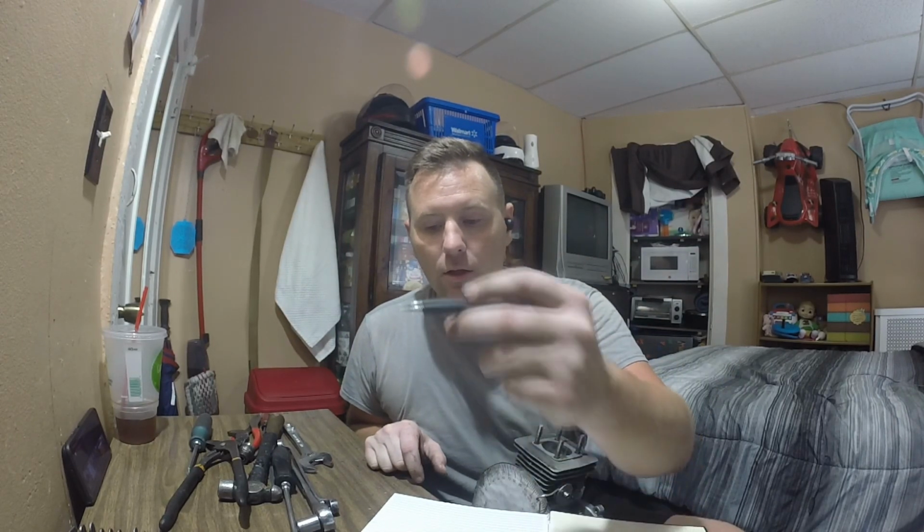What I have noticed, if you run your intake lower than the transfers, or even within the first couple degrees of the same, you will have a much higher revving motor and not much stump pulling power. I like the stump pulling power because I am constantly pulling a stump. So that's why I do that. So we got everything we needed, we're done. This is trash.